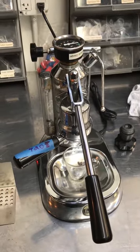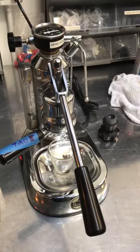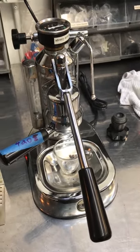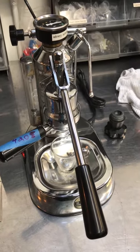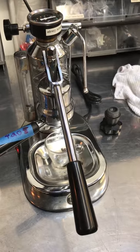Hello and welcome to Cannon Coffee Espresso Machines. Today we're testing this beautiful La Pavone Espresso Machine. This machine had low pressure, so we replaced the pressure sensor and the pressure stat, and now the pressure is good again.